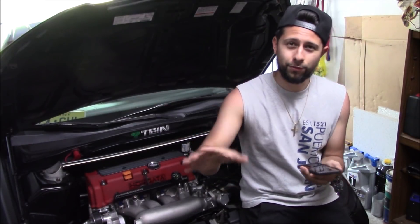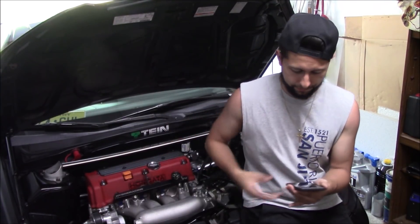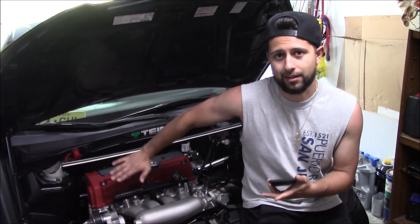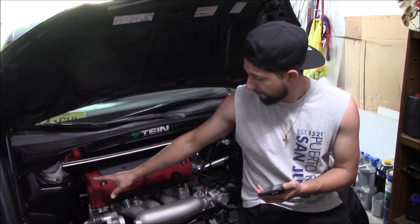So we are at exactly $3,400 just to go K20/K24, turnkey. If you subtract about $1,600 — meaning you skip the cams and the full block machine work — you're looking at about $2,000 just to go K20/K24. Now for add-ons: a new chain, tensioner, gaskets, seals, and you need to swap the RSX post mount to a CRV post mount to make it fit. A new head gasket included — all of that is going to cost you about $400 extra.